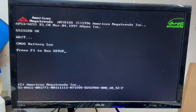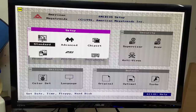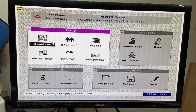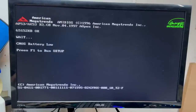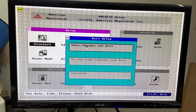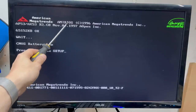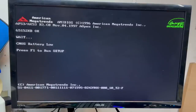It did count the correct amount of RAM, so that's good. Let's run setup — it's got that GUI BIOS. The monitor is doing some weird things. I don't have much to set up in here, so let's connect the floppy drive and see if we can get it past the CMOS error. Floppy drive's connected, got the DOS boot disk in — we may not be getting past that CMOS error. Floppy drive is set correctly but I don't think it's going to let me override. I'm going to have to replace that RTC — I don't have anything on hand for that, so that's as far as we're getting with this system. The results are encouraging; it does at least post, though there's a little weirdness on screen. There's no telling what kind of weird faults this thing might have with the bad RTC, so we'll investigate in a future video.